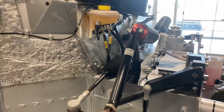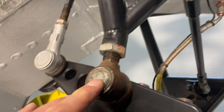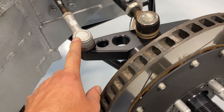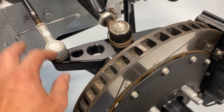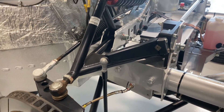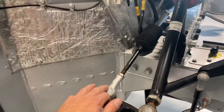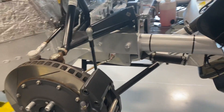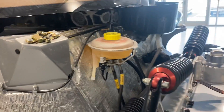In the front, the connections look like standard ball joints rather than rose joints, and there's a little bit of a rubber buffer. We've got the anti-roll bar here in the front, and then upper and lower A-arms and inboard rear suspension in the rear. That's the steering rack sitting over there. There's no brake booster on the car, and we've got the brake fluid reservoir there.